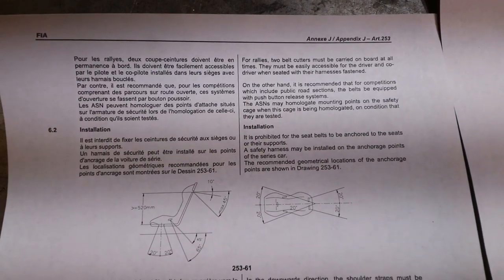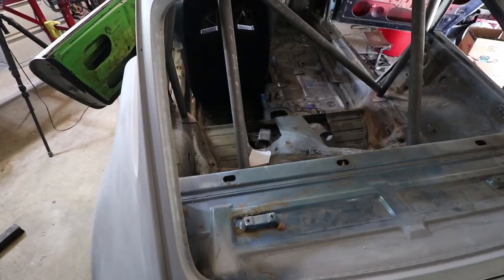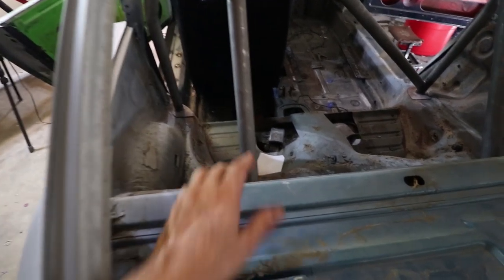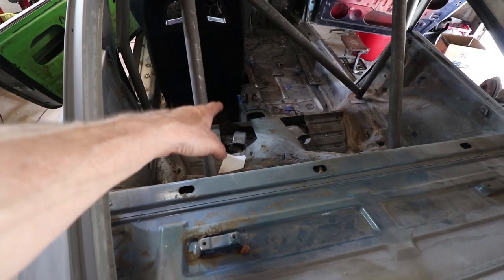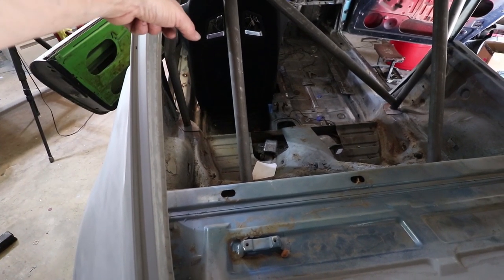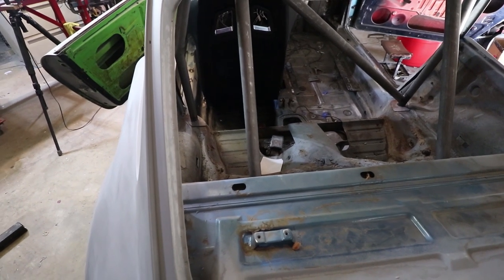On this page, they actually recommend adding the harness bar between the backstays. And let's go look at the car. This happens to basically line up pretty well with the seat center. This is the driver's side, and it lines up pretty well with the seat center. So if I was to put a bar between these diagonals, then I could attach this shoulder strap pretty easily. It'd be way long because it comes all the way down to about here. But there's nothing to attach this side to. I suppose I could do that less than 20 degree angle this way, but then the two straps would be kind of on top of each other. I'm not sure that is allowed.